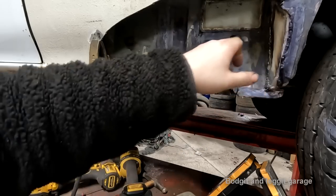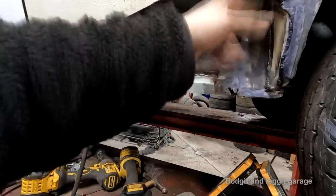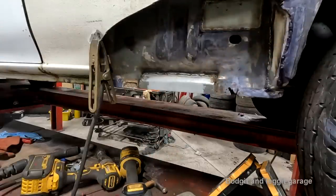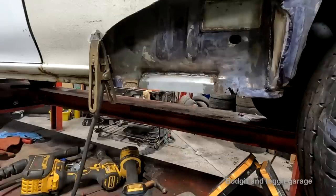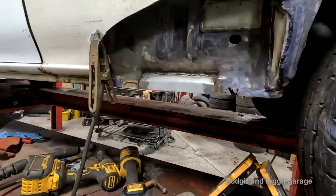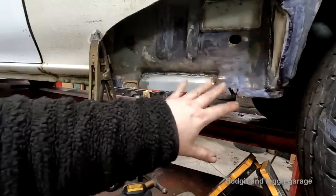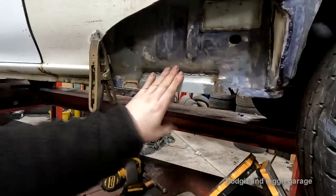I don't think I will, because we've got holes here, and with the machine I've got to wax all this, it will get all that. And I'm going to show you how to wax all of it, and that's the important part. If you were to keep these passages clean and wax oil this every couple of years, if you got it brand new, let's say, I guarantee you this will never ever happen. It's these blocking up, it's the water and the crap sitting there which is causing it to rust over years and years. So anyway, that is how you do it.